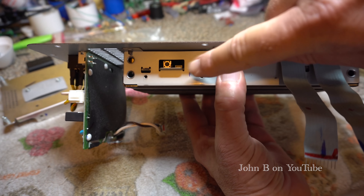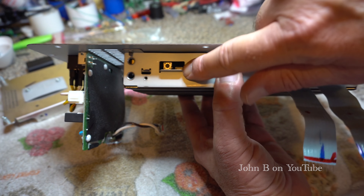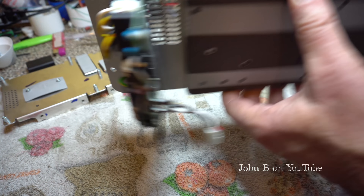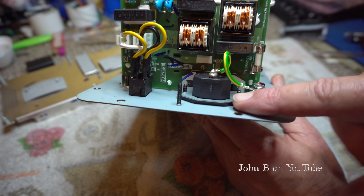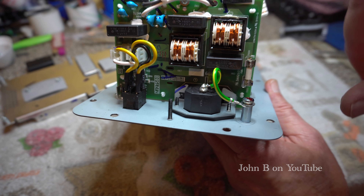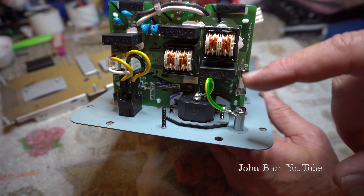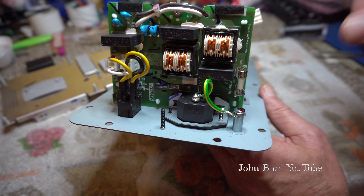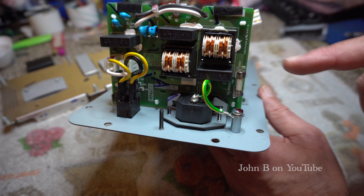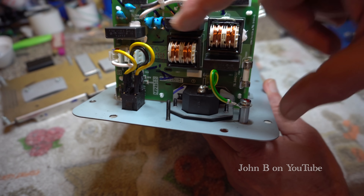Have a look at the manual — there's some sort of reset there, and it can actually be updated via Yamaha, so you can update to the latest firmware. Main socket — so that's the mains filter. In case you're confused, this stops the switch mode power supply noise getting back out onto the mains, not mains interference getting into the amp, although I'm sure it does suppress a small bit. These are called common mode chokes, with a couple of capacitors there and one over there.